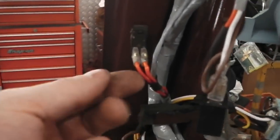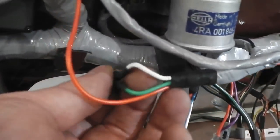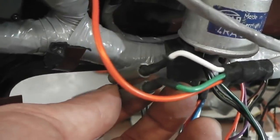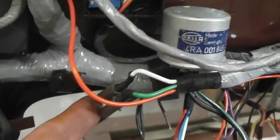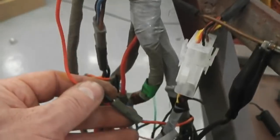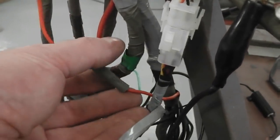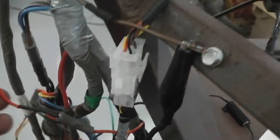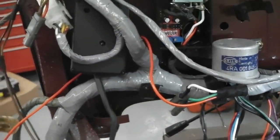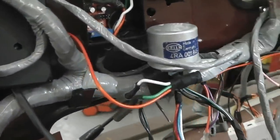Hazard switch there then. Very neat look. Tied into the loom. Loom wrapped, goes down, round, hooks into the existing hazard socket receptacles, which are left and right indicate lines. Then the power feed for it does exactly what the factory would have done and hooks into the auxiliary permanent live there. So the only downside I've got is an exposed single red cable. I don't like that, but there's nothing I can do.